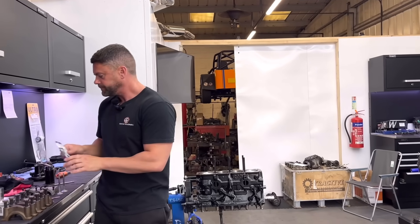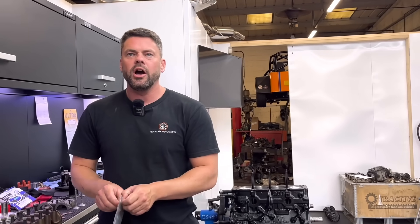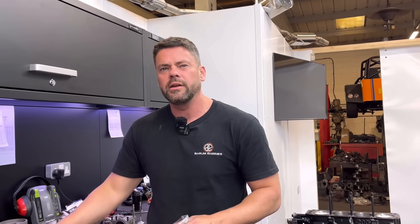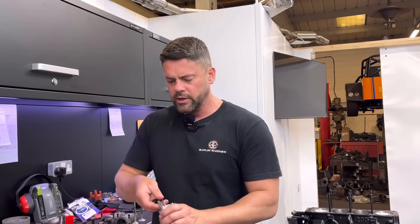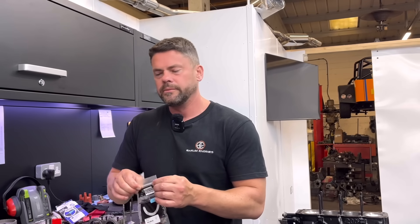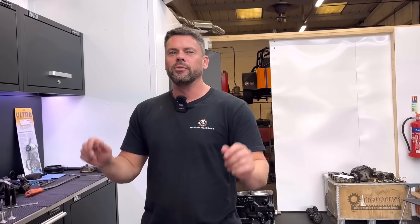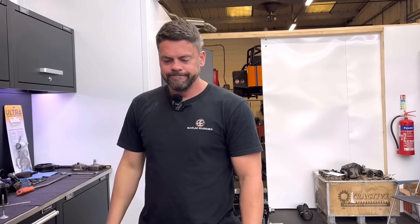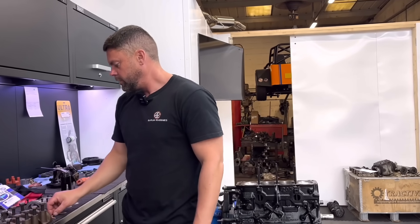So is that a 1.8 turbo or a VR6? The R32 Golf was basically the Mark four, four wheel drive, VR6 but with four valves per cylinder. So pretty much the same bottom end — 3.2 litre, something like that, bit bored out. Pretty much similar engine, but I like them though. Awesome car. Always one of the only Golfs I'd have — in that lovely dark blue they do. That's the only Golf I think I'd ever have. It's a Mark four — lovely car.